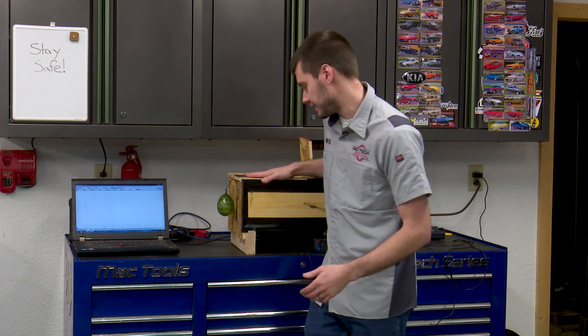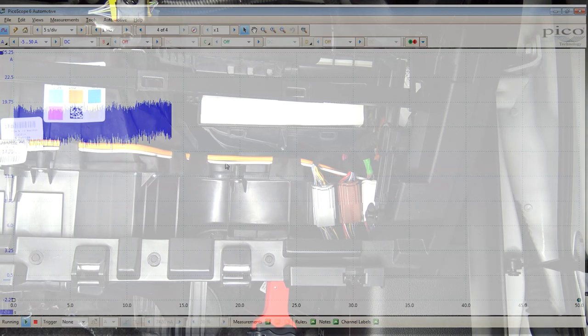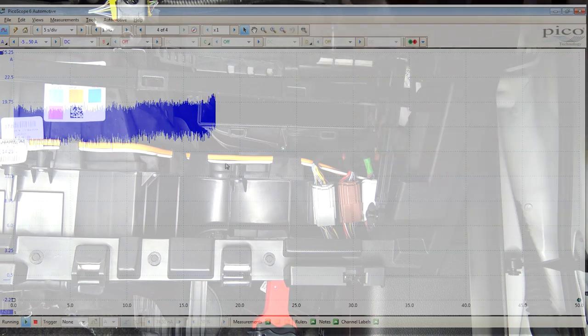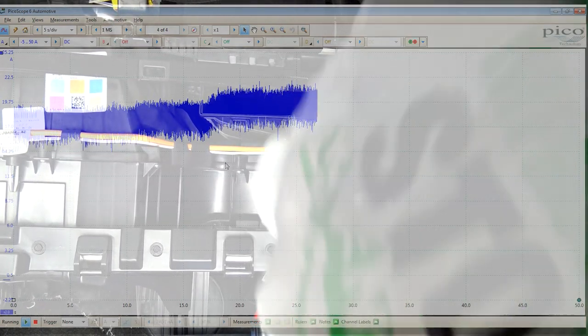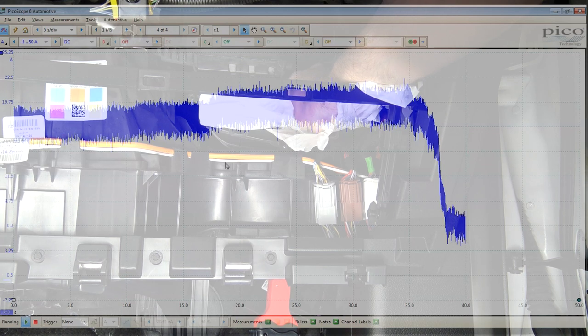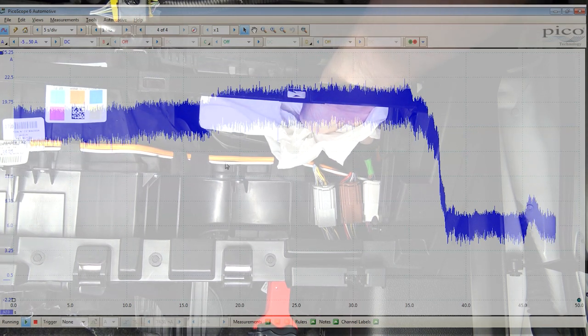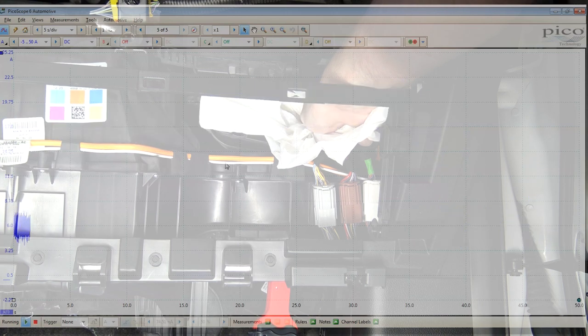We're going to show a vehicle, and also this nifty contraption I built to do a little bit of experimentation with. We're under the dash of my 2016 F-150, running the blower motor on high. You can see we've got the glove box and everything out of the way. Cabin filter's exposed. We're pulling our current draw and it's actually relatively high on this vehicle. Now you can see as soon as we pull out the cabin filter, the current actually goes up because we're pulling restriction out — we're allowing more air to get into that blower motor itself, therefore loading the motor even further. Now I've got this plastic bag; we're going to throw the cabin air filter — which by the way is relatively clean — into the plastic bag and throw it back into the heater case. Right away I can feel a suction on that plastic bag, but look at our current — it dropped down significantly, almost down to six amps.